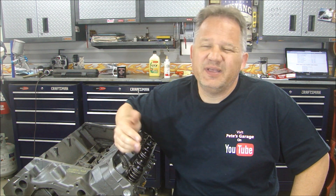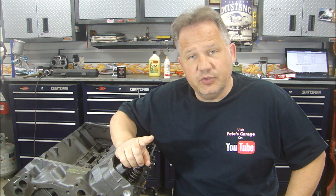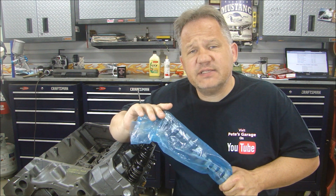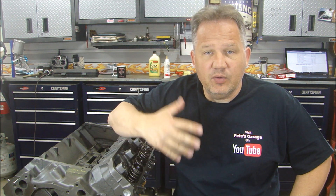I bought these heads and took them apart. Fortunately, everything was in great shape. I did have a bent valve — I had to change a valve and change the valve guides to make sure those were all okay. But the heads were in very good shape. So the question then became, with the cam we used, could we reuse the valve springs that were in the head? The springs were in excellent condition, recently rebuilt. So what we're going to do is we'll take a look at the cam card, compare it to the cam in the last 440 we built, and see how we knew that the springs in the head would work with this cam.